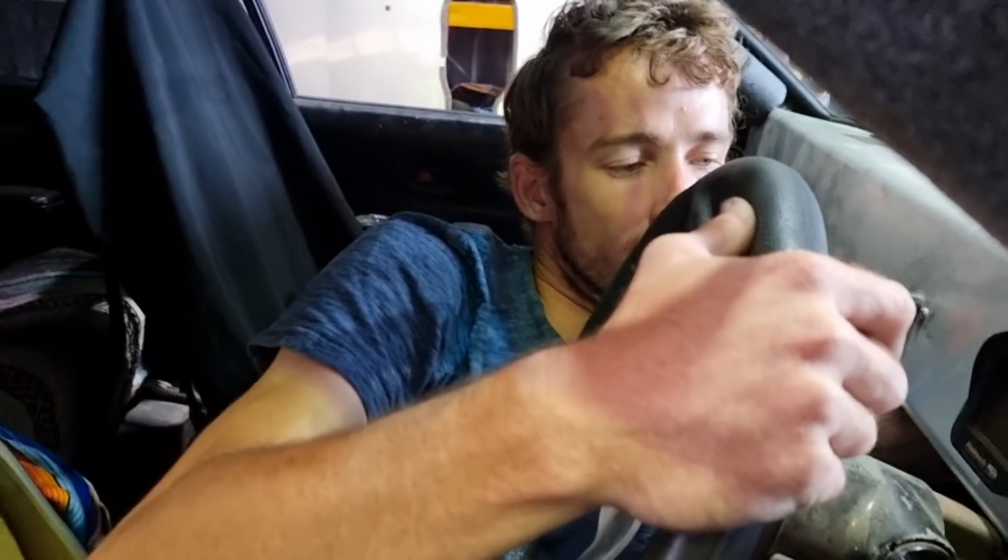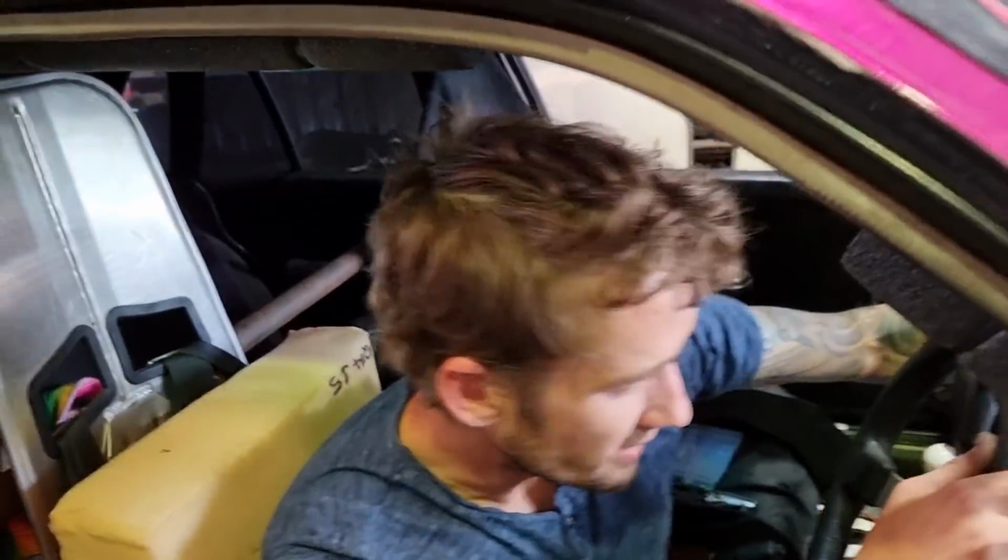We're going to download the software, play around with the settings in there, and see if we can get this dash working, because that'd be ideal. Like, that's what we're trying to do, is get that dash working to what Craig is used to. So oil pressure, RPM. Oil pressure and RPM, yeah, 100%. Water temp, we get to figure it out. Yeah. If only MSD would make a plug-in.